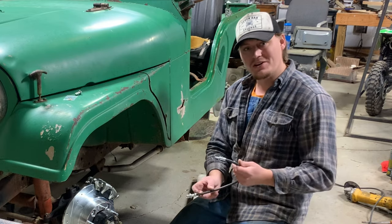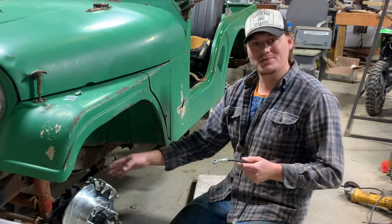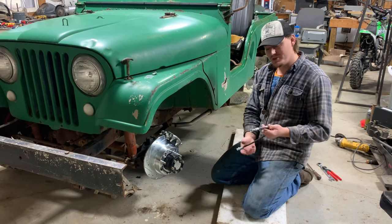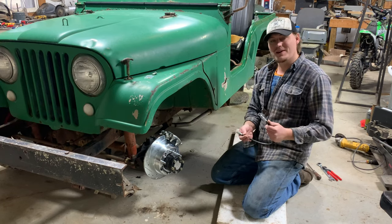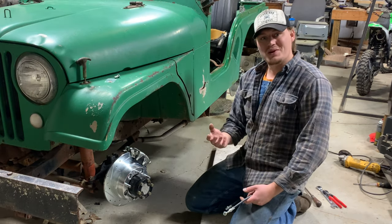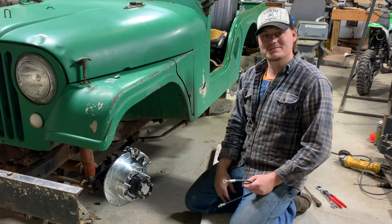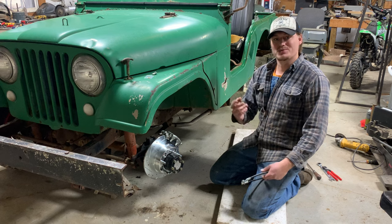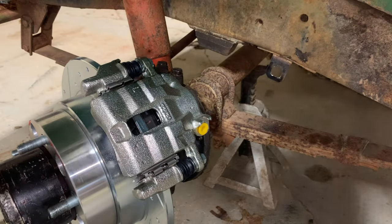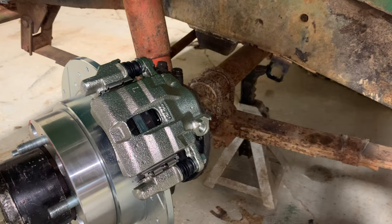It's going to be your brake hoses, and that's the hose that goes from the caliper to the frame or to your axle. Now, in my case, I'm using some Honda Accord, I think 85 or 86 Honda Accord brake lines. On Brennan's website, he's got like a whole list of part numbers and hoses that work for this. I think S10 brake hoses are really popular. This part is pretty straightforward. So right here is where the hose is gonna go in at.